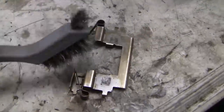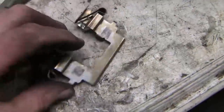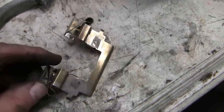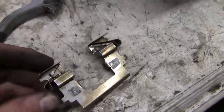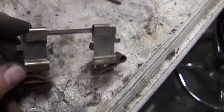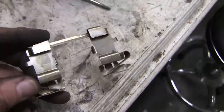Then the metal clips — I've cleaned these up with a wire brush. I'll slip them back on with a press fit and put some anti-seize on the critical areas to try and prevent rust from forming. Here's the top clip — I took that out, cleaned it off with a wire brush, put a little dab of anti-seize on the rubbing areas, and now let's put it back together.